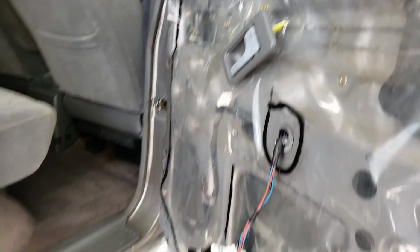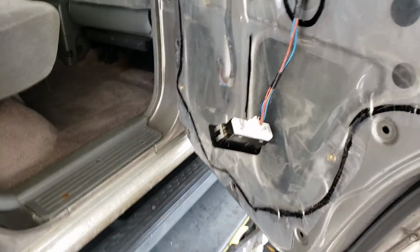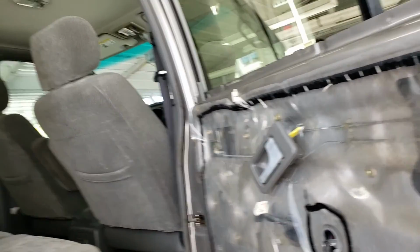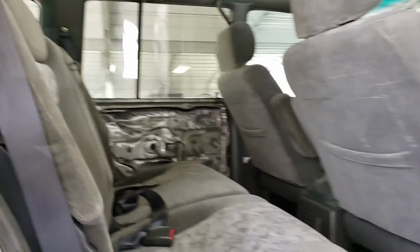The one I had on the shelf was motorless, so I may take the motor off of here. And then I always have a spare. The front window regulators are different than the rear. So don't be fooled and think the door handles aren't. You can move the rear door handle on that same side up, but you can't do that with the window regulators. The right rear and the left rear are different, and the right front and the left front are different.